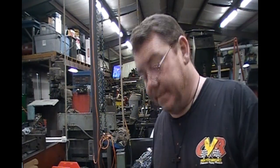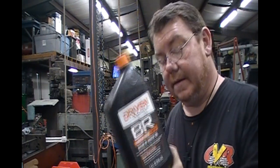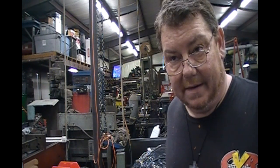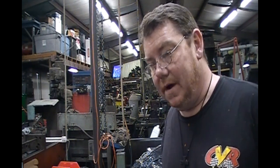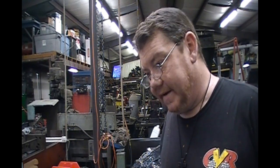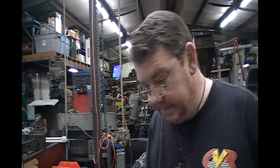The number one thing is our oil — they took the zinc out of our oil. I personally recommend Driven break-in oil — it's Driven BR — for any flat tappet engine. I know there's a lot of guys that use VR1, and there's nothing wrong with it. It's still got zinc in it. There are a lot of other oils out there, but this oil is designed for breaking in a flat tappet camshaft.